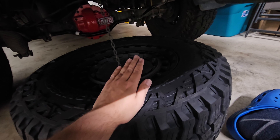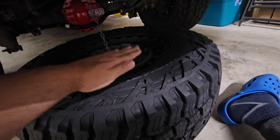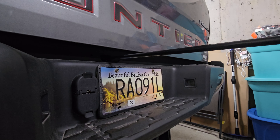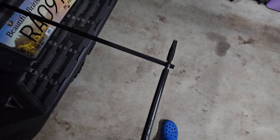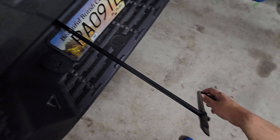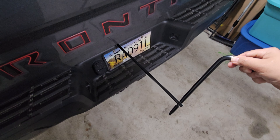You want that plate to be flat because if it's on the ground at an angle, or hooked on something weird, it could end up going sideways. Now we're going to crank this thing back up and it's going to slowly pick up the wheel. Now that the wheel is under there, you can see you just dropped it with your fingers, but with the weight of the wheel this is where the handle comes in. Just turn it — you may want to use two hands so it doesn't wobble. Keep one hand to guide it and just keep turning. Eventually when the slack runs out and you start picking up the weight, it'll get a little heavier. Crank it all the way up and see if she works.